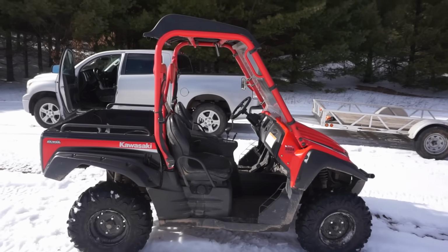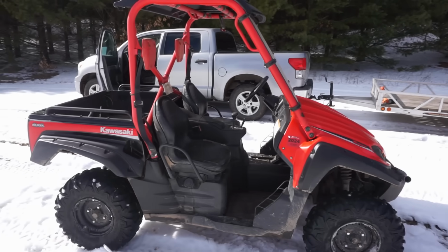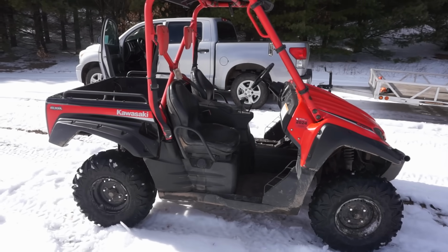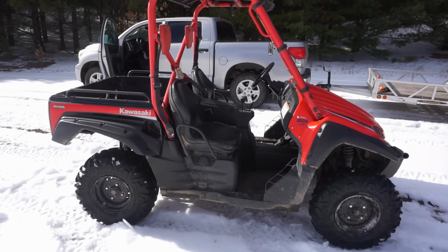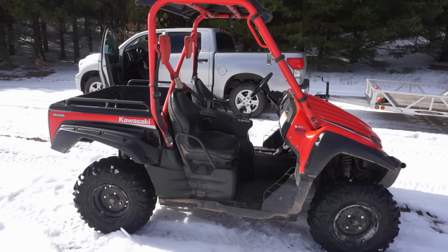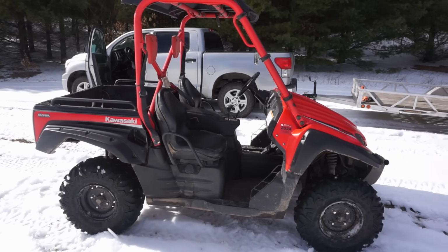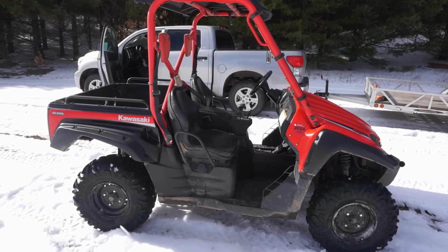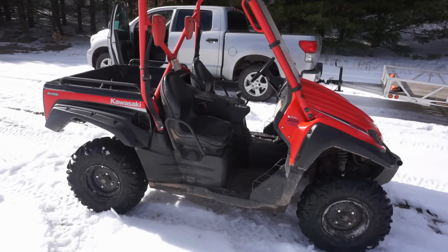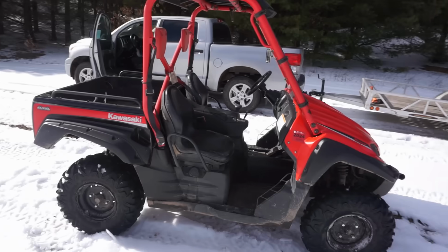Alright, so I think that wraps up today's video. We got super lucky on this one. The dealership that sold it to the guy I bought it from said it was low compression. And the reason I bought it is because I asked the guy what compression does it have, and he said around 60. So I looked it up, and then they're like, well, it's supposed to have 60. So I'm like, okay, well, maybe it's just a valve issue or a carb issue, and it turned out to be a carb issue, which was an amazing deal.